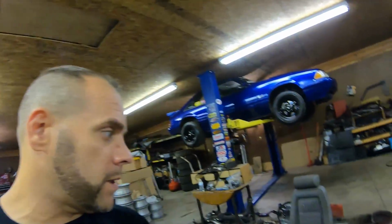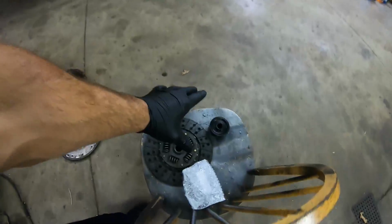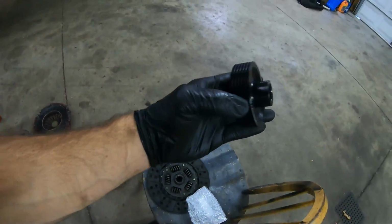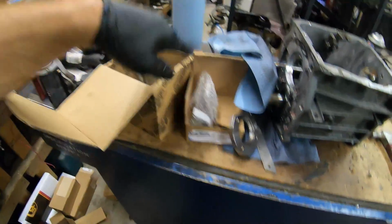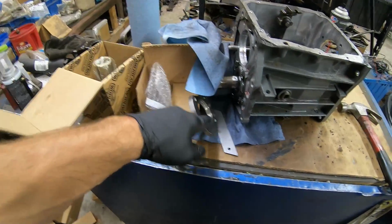How are we going to make this damn car go 11's, stock block with slicks and literally an exhaust? Fix the clutch issue that we had already had. A smaller pulley on, change the belt. We're going to tighten this transmission up so it supports it and we stop missing gears. And then I'm going to support it with the front bearing retainer and the countershaft retainer. So that's how we're going to go faster tonight.